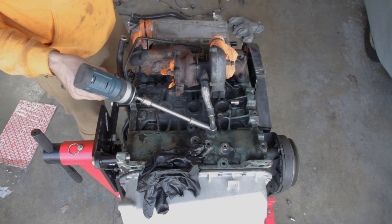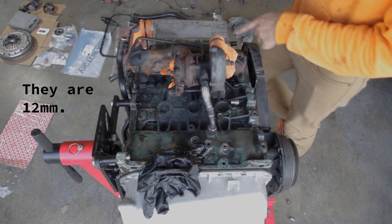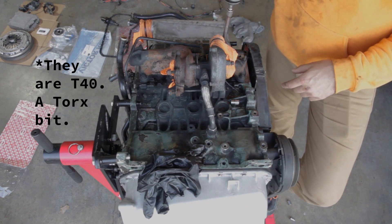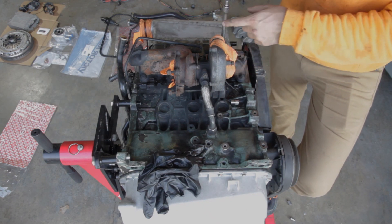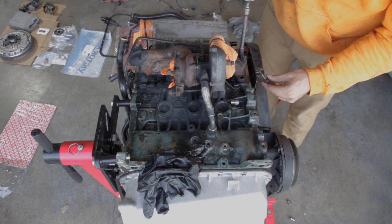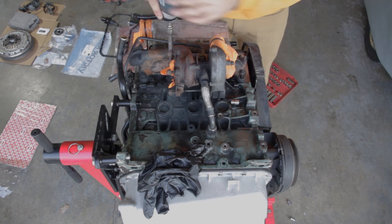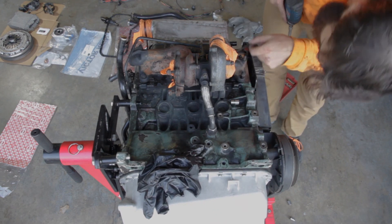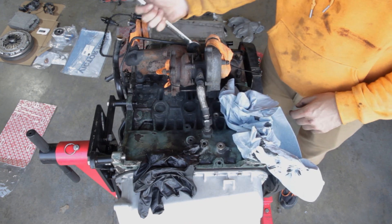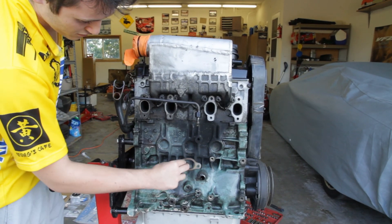The turbo's probably going to come off, so we'll take this off. This line probably needs to come off too — it's just a few bolts. These are 13s and then these are Allens. I'm not sure what size they are — probably T40 or something would work, star bit. And then we'll put our newer manifolds on them. They are 12s. So the stud came with it — looks like I'm probably going to be replacing these studs, that's okay. And it looks like that last one is probably going to need it. That wasn't bad. Then we got this one off — I think it was a 22 or something. I just used an adjustable wrench. And then we're taking off this other flare nut over here on this line, and then we'll take off this manifold.